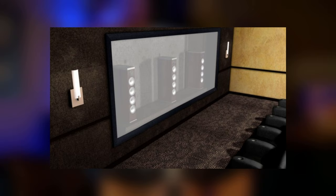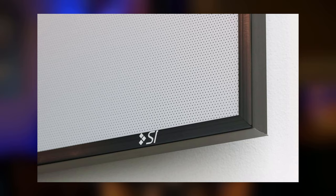The last type of material I want to mention is acoustically transparent screen material. This kind of material is designed to allow sound from your speakers to pass through, so you can put your whole front stage behind the screen — a lot like a real movie theater. You can get acoustically transparent screens with either perforated or woven materials. Perforated screen material is similar to regular screen material, with the biggest difference being tiny holes to let sound through. These give great image quality but can suffer from the moiré effect, where you get visible lines in the image that line up with the pattern of the dots. Woven screens are better at passing sound through, but suffer from image artifacts like poor color temperature and double imaging. If you don't need to put your speakers behind your screen, you probably don't need to worry about acoustically transparent materials.